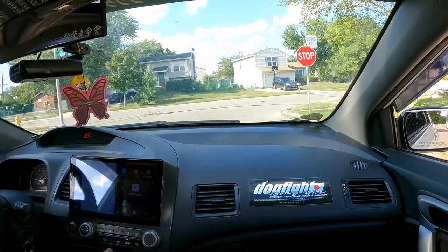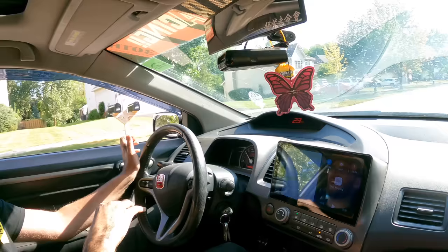Dude, that was good - speed bump test was successful. It's daily drivable. This feels good - so good to be back on Stance suspension. This feels great. It feels planted and responsive - I can't wait to do some driving. Dude, steering's more direct. When turning in neighborhoods, it was loose enough to where the car would kind of rotate. And the reason for that is the droop we were talking about - the wheels used to bolt on super low, and then as you put the car on the ground, it would suck up into the chassis. With the new suspension, there's less droop, and that will affect your left and right handling in a big way. This thing's way more planted to the ground.